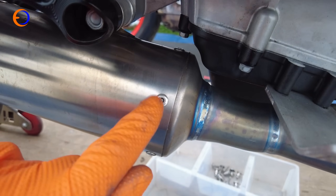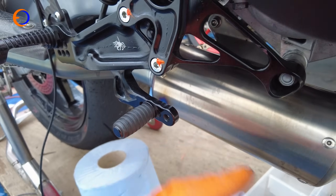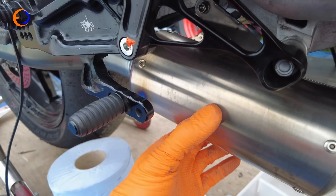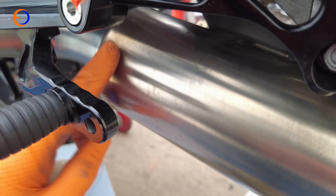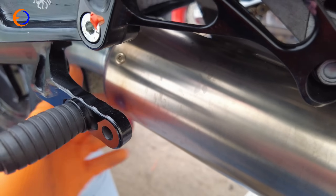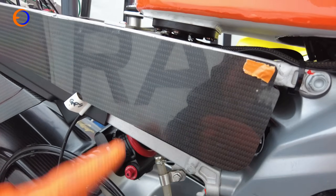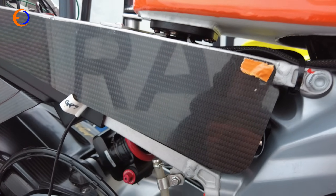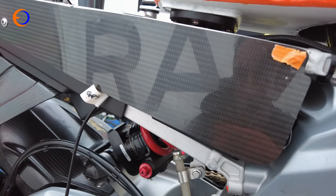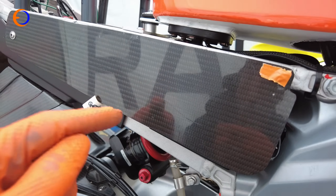It's worth checking the rivets on the silencers. This bike has a centre silencer and it gets quite hot in places — especially with twins the power pulses try to rattle the silencers apart, so always check the rivets aren't coming loose and aren't starting to rattle in the silencer. Behind my carbon side trim panel there's a GPS system that we have to run here at TT; I've made sure that's on charge, and I've also taken the timing transponder off the other side and put that on charge as well.